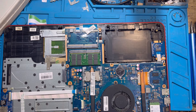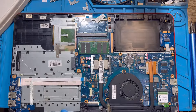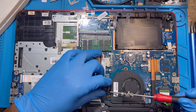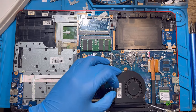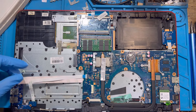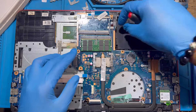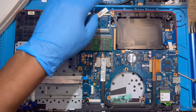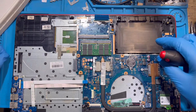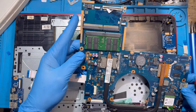This corner is the Wi-Fi card — remove the Wi-Fi cables like this. Take out the processor fan. Remove the processor fan on one side. Try to remove the motherboard — disconnect the connectors. This one is for the on and off button. This connector goes up here also.